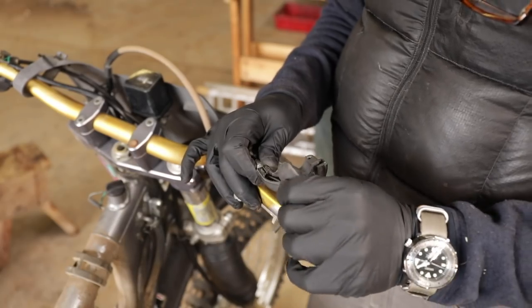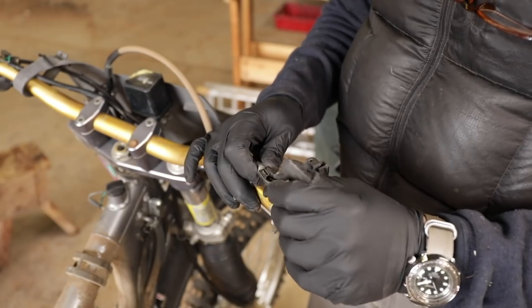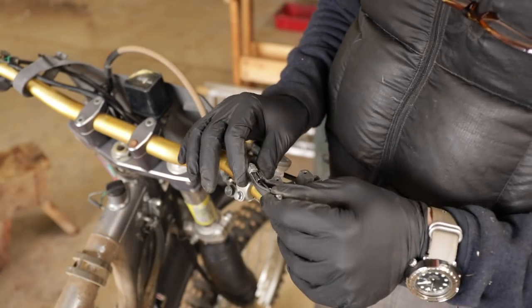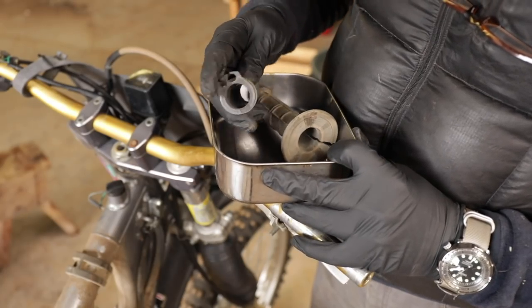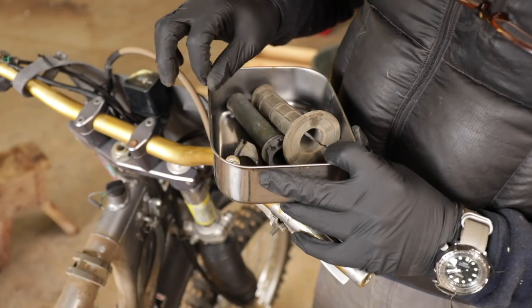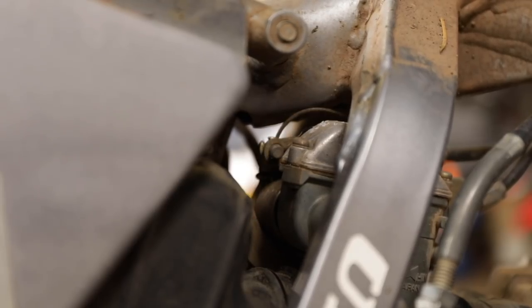The cable should be replaced, but I don't know how far he wants to go into this. So what we can probably do, though it's going to be a little bit sluggish, is lubricate that cable down from the top here and then clean everything else out. All of this stuff, the cam and all that, is gunky and gummed up and full of cobwebs. We can clean that out and put some lubricant on there. It's a half measure, but it'll work.